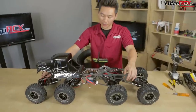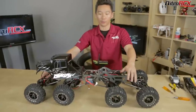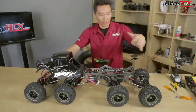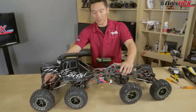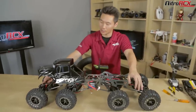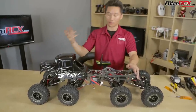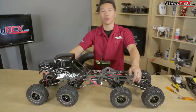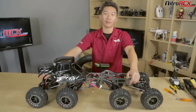We're going to take it out for a spin. Hopefully that gave you a better idea of how the eight wheel steering works — it's pretty similar to four wheel steering, you just install another servo on the extra axle and include a Y harness. For more detailed specs and pictures on the crawler or the parts, head over to NitroRCX.com. We have plenty of crawlers from big to small — six wheels, eight wheels, four wheels. Be sure to subscribe, click like if you enjoyed this video, and we'll catch you guys next time.